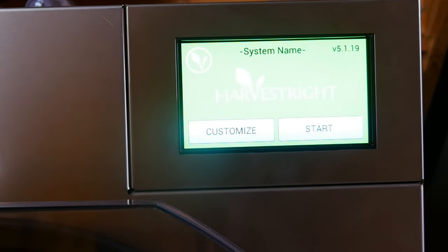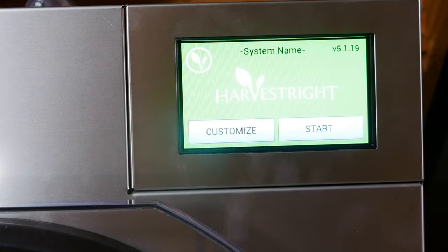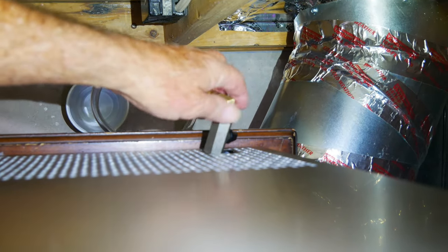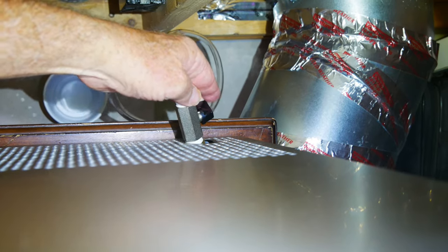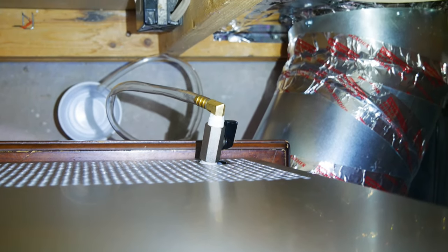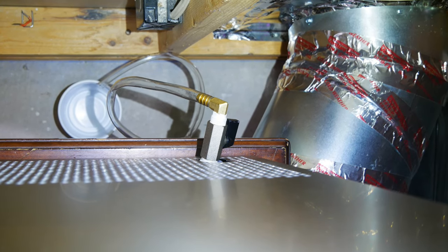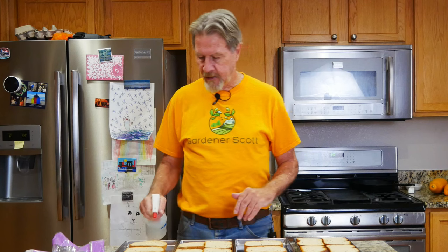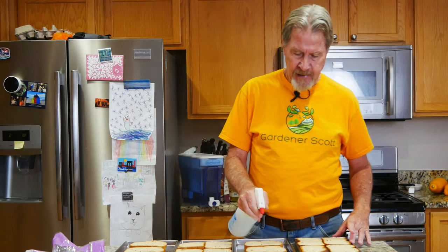The functional testing is successful. Now to relieve the pressure, I'll go ahead and open up the drain valve. I've attached the plastic hose that comes with the machine — that's what water drains out of. Opening the valve releases any air and lets any water inside drain out. Harvest Right suggests a burn-in period with a brand new freeze dryer by doing a batch with bread, specifically moist bread. So this is an old loaf of bread, but I'm going to go ahead and spritz it with water just to moisten it a little bit, and then we'll put it in the freeze dryer.